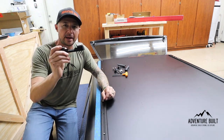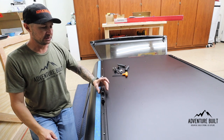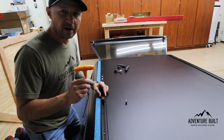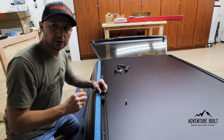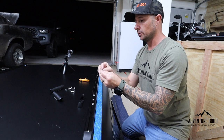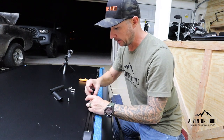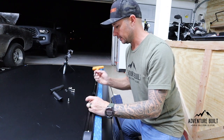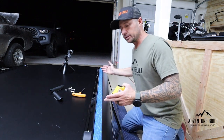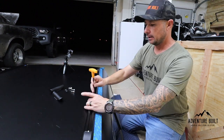These little guys are called the landing pads. These attach to the base plate nuts that we put inside the track, and your feet attach to these. Pretty straightforward — you just screw them in and tighten everything up with a five millimeter allen key, keeping everything loose so it can slide on the track. When putting these feet on, all I'm doing is sliding the bracket over with my screw, washer, and spacer. I'm moving the spacer over by hand until I can see it, then drop the bolt onto it and give it a couple turns to snug it down. I want my bars 35 inches apart — that's what they are in my other truck, which is basically the width of all my racks and my rooftop tent.